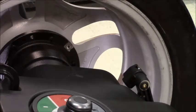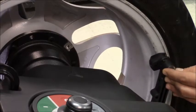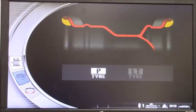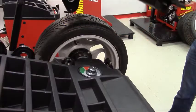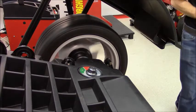Let's say we want to use a clip-on weight, so the dynamic program with two weights at the two extremities of the wheel. All I need to do is grab our measuring arm and gauge and place it at the edge of the wheel. Once we detect the size of the wheel, the machine defaults to passenger tires. All you need to do is lower the hood. If you have a light truck tire, just select the second option and lower the hood again. During the spin, we also have a sonar system on this side of the hood, which helps pick up the width of the wheel for maximum precision in measurements.